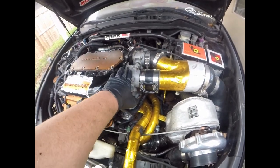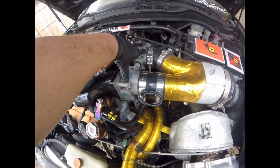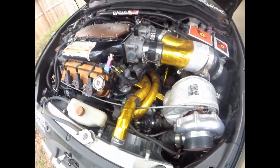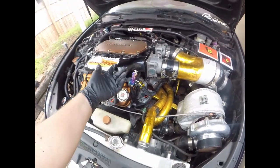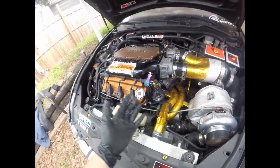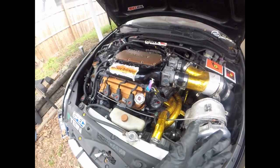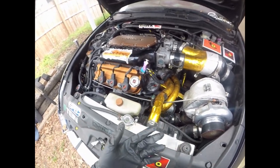because, or I can just remove the throttle bodies, but honestly, I always leave these attached. I always leave the throttle body attached to the intake manifold just so I don't have to reuse a gasket. So I just pull the intake manifold because it has an MLS gasket, and then I do the copper spray over it. And guys, I've reused MLS gaskets forever. Always use the copper spray on it, and I've never had an issue.